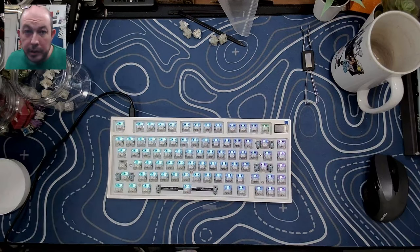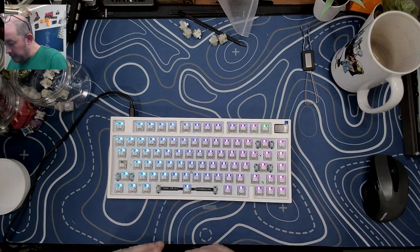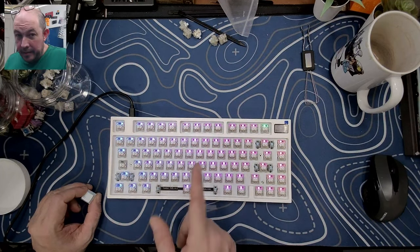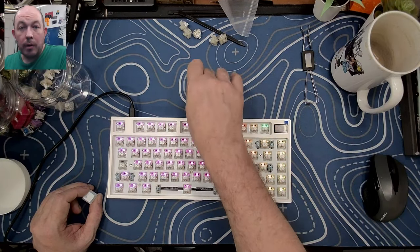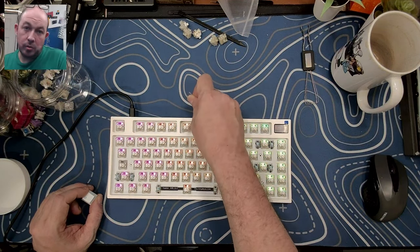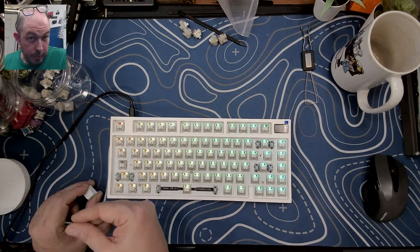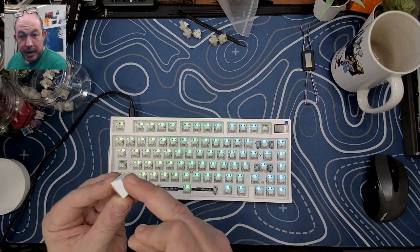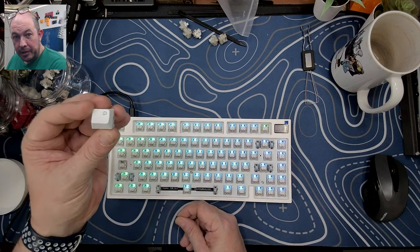All right, so before I loaded keys up on here, I wanted to just do real quick. Now, I understand a lot of people are talking about north-facing interference. I haven't tested these yet to make sure, but most new switches have already been modified. The molds have been modified. There are still some older switches that are sitting in inventory that are going out that have that. They don't have the right degree of slope, and that slope is what can cause an extra tap when you press down, especially on the keys in the middle rows when dealing with thicker Cherry keycap profiles.